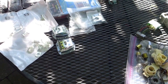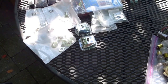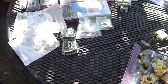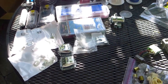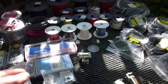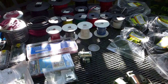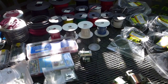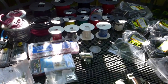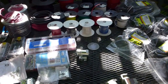The way my system is going to work: I have Lithium Pros as the company that makes the lithium iron batteries — JEGS and others sell them. It's a 12.8-volt, 20 amp-hour battery. You can go lower amp-hour on lithium compared to lead acid because the battery has a much flatter discharge rate — it'll hold its voltage until the bitter end and then drop off, and you can discharge it a lot further without damaging it. Lead acid batteries you have to be careful not to discharge too far or you destroy the chemistry. A traditional Mark I Golf battery would be in the 30 amp-hour range, so a 20 amp-hour lithium is comparable.